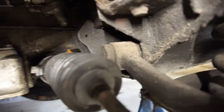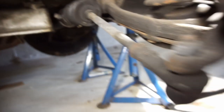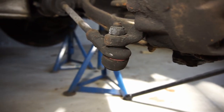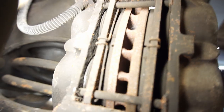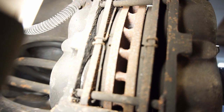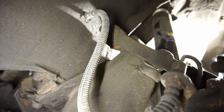Let's check the bushing in there — kind of hard to tell on camera but that looks really good as well, doesn't look worn out, and it's not soggy from any oil, so that looks really good. The bushings down there look really good too — I can't see them separating at all. Let's check this side as well — that looks really good. Can't see any leaks from the power steering on this side so that's really good, everything looks nice and dry. That looks not too old as well, so I think everything has had a suspension overhaul not that long ago. There's still some meat left on those brake pads — I'd say more than 50% at least, so that's not bad at all. And I can't see any leaks coming from around the brake caliper — looks all nice and dry. And that flexible hose doesn't look very old either, so far really good news over here.